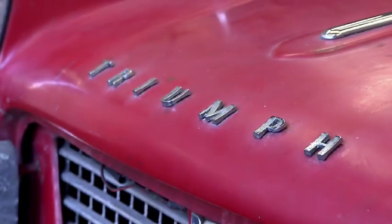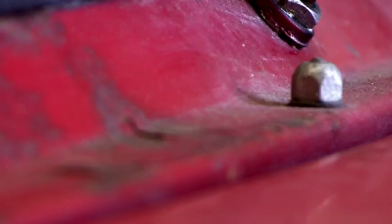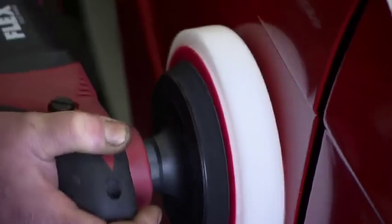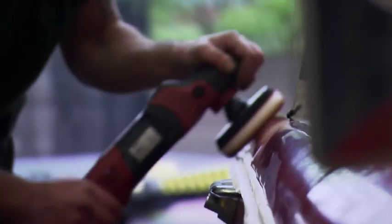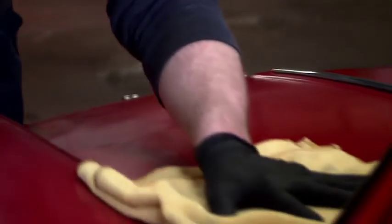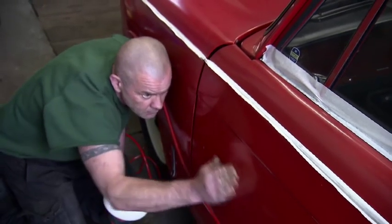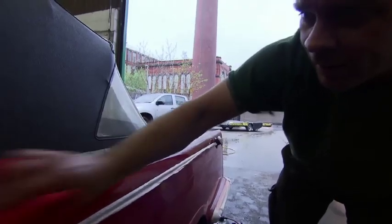The old-fashioned cellulose paint has been oxidizing since 1966, which is why it looks so milky. We're using a mildly abrasive cream to remove all the dead finish on top of the paint. When she's back to the original signal red, she gets a good polish and a good waxing. A regular waxing will preserve a car's paint by stopping dirt and grime becoming bonded to the paint.